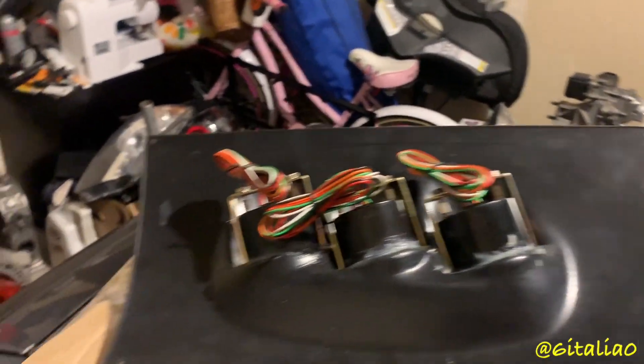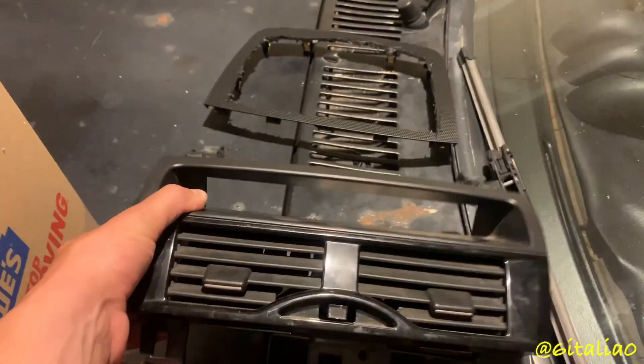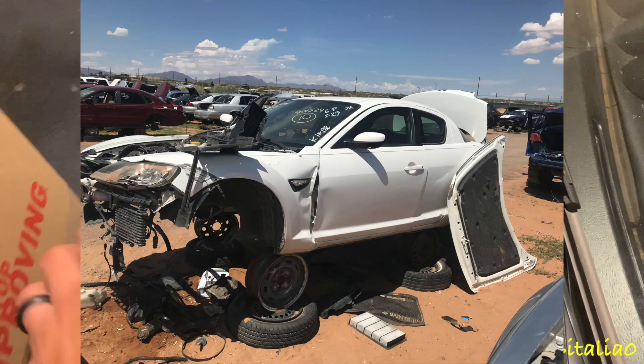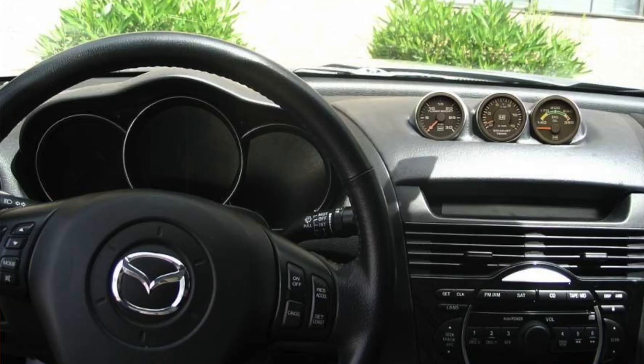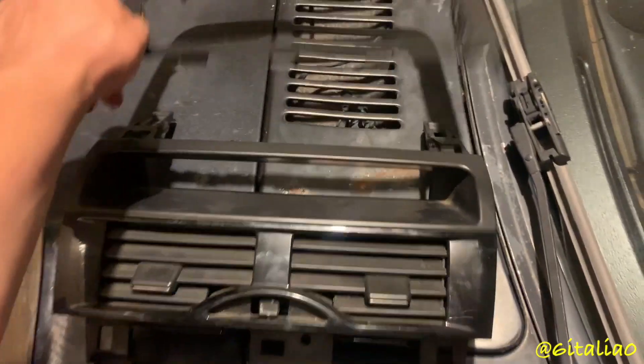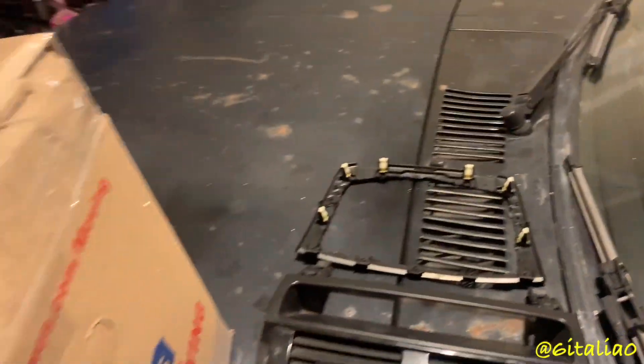So here's what I've got to work with. This was originally meant for the other car — the RX-8 in storage, the Series 2 slash Series 1 swap project that I completely ditched because I got the R3 — but here is a Lotek gauge pod for a Series 1 RX-8. Over here I have a Series 2 center console top piece that I pulled from a junkyard in Texas and modified a little bit. The problem is the shapes don't match up at all, so what I'm going to do is cut out the center of this piece and use it as a template to mark where I'll cut and modify it to fit in a Series 2.